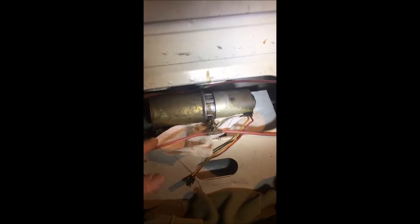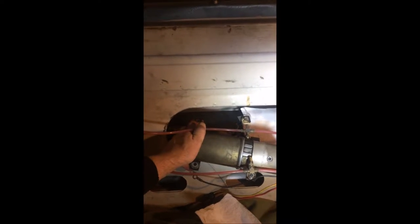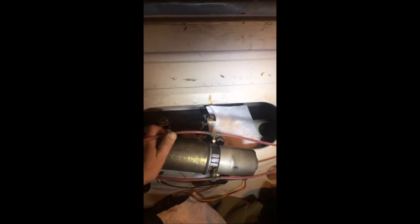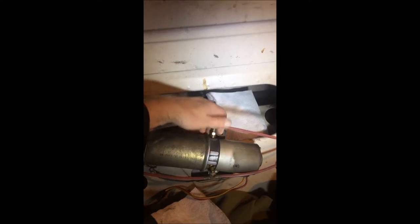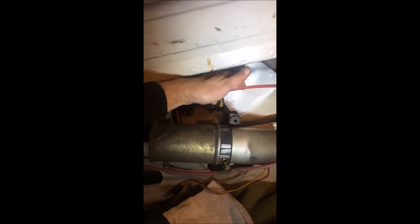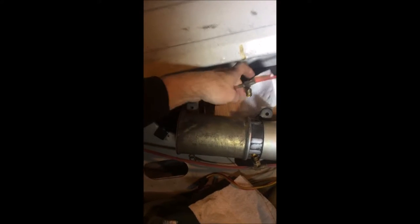What I'm going to do is pull this out, take off the one in the back, and then I'll be back in just a moment on the workbench to disassemble it. So I've had to actually pull the pump off its mounting bracket to get to the back fitting — I wasn't able to do that with the pump in place. The pump is going to probably fall here as soon as I disconnect this fitting. It uses Type A transmission fluid as the hydraulic fluid in it.